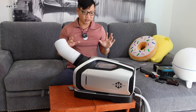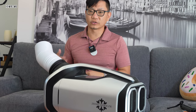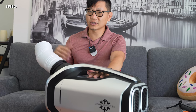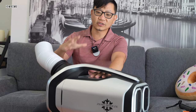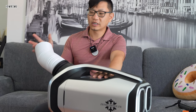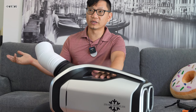This is really designed to cool one person — not really a whole party of people, at most two people — because the capacity is only 2300 BTUs. A traditional window air conditioner typically starts at about 5000 BTU for around a hundred dollars, so this is roughly half that. With that in mind, if you're thinking about using this unit in an enclosed environment in the sun — like a desert environment — it's really not going to cool you off that much. It'll cool exactly the spot it's pointing at, and then basically nothing else. It is not going to cool down an oven.